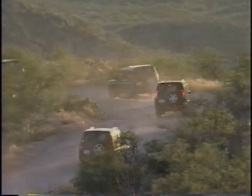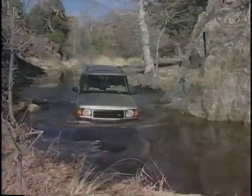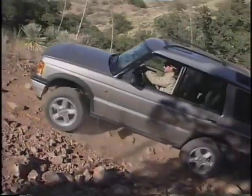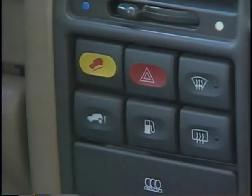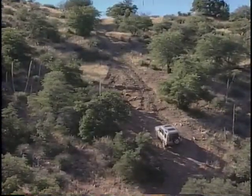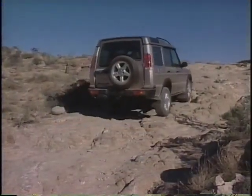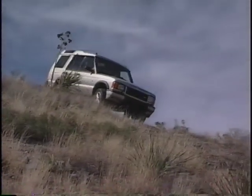Your Discovery Series 2 is designed to provide many years of off-road driving when operated properly. This Land Rover is purpose-built with a highly sophisticated braking system to help provide maximum traction in varied situations — the world's most advanced four-wheel, four-channel, all-terrain anti-lock braking system, with the additional benefits of hill descent control and four-wheel electronic traction control. Before getting started, read your owner's manual. Get familiar with the vehicle, its size, operation, and capability. For most off-road driving, use third gear, low range. First gear for any descent, with hill descent control for added performance.